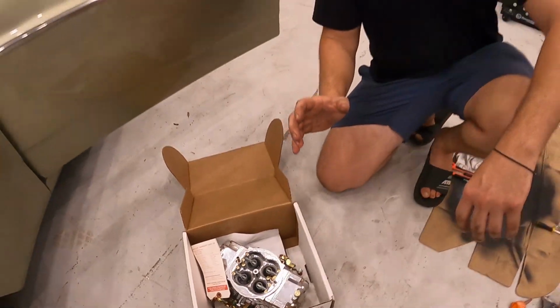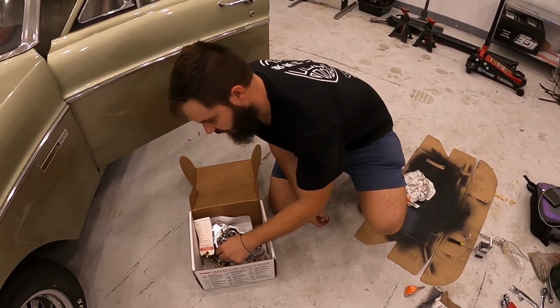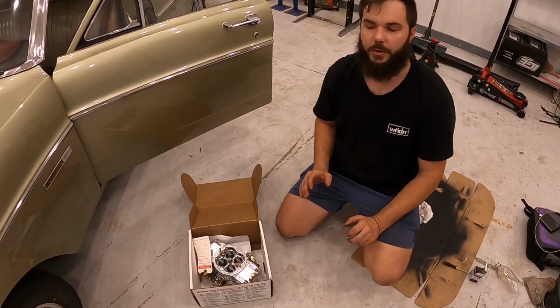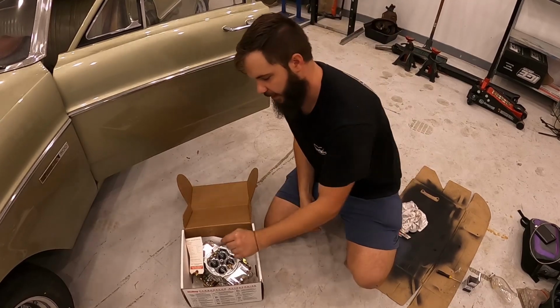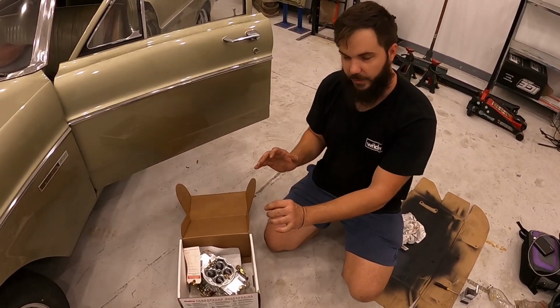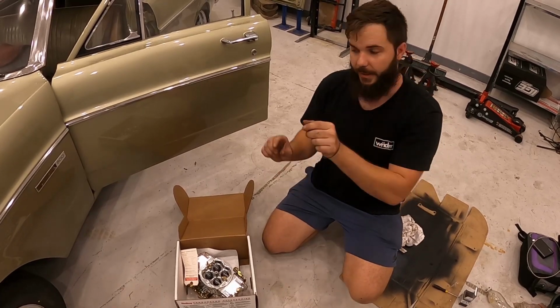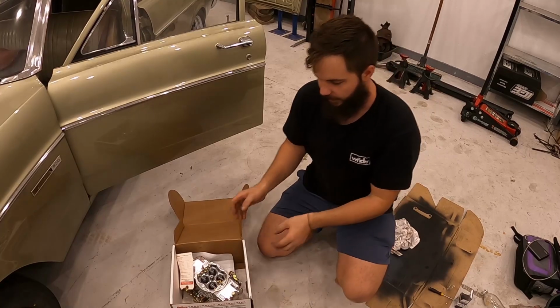Okay, let's get that twin feed. The problem, while you're talking about the idle transfer, is people will just touch that screw straight away because there's a vacuum leak or the timing's out or something. They want more RPM, so they'll go straight to that screw. Guys, don't do it, because when the slot's set up perfect, you don't want to lose it. If you have to touch it, remember the turns, quarter turn, half turn, and remember where the point was when it was originally set up.